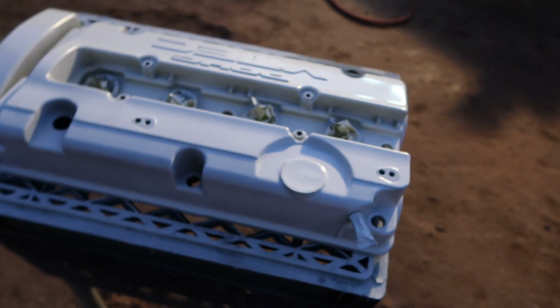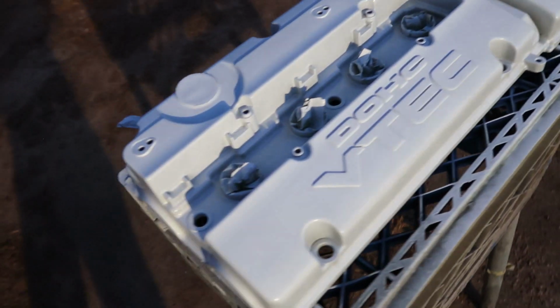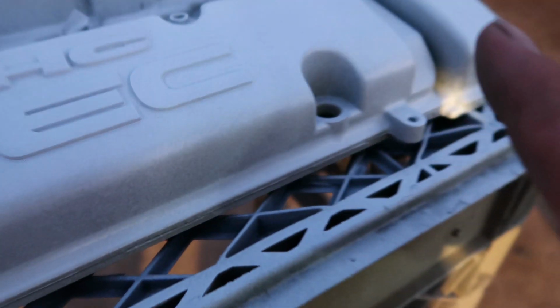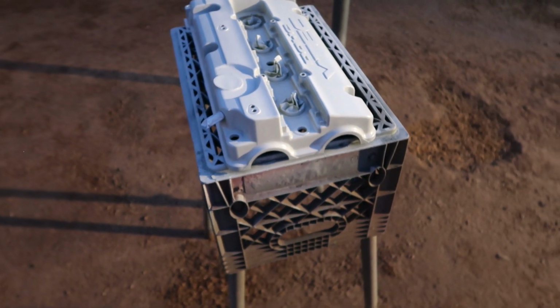I didn't do that because I'm used to spraying this. I literally paint every single day of my life, bro. So with white on the first coat, I basically leave it transparent, dude. I don't try to cover absolutely everything. I just do a nice thin layer, so as you can see on the side, you still see primer through it. That's fine, especially on the first coat, because if you try to get too heavy, from my experience with whites and yellows, sometimes red even, you'll end up getting a run, dude. So you got to be kind of patient with it.